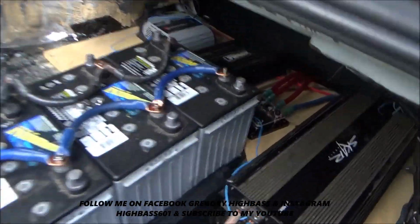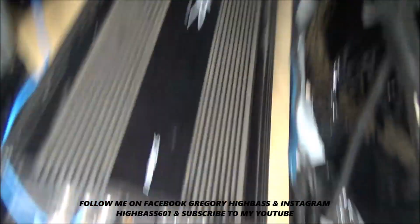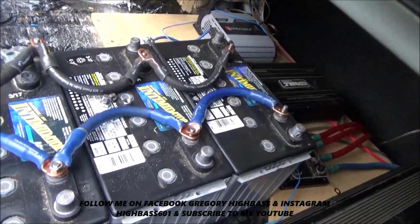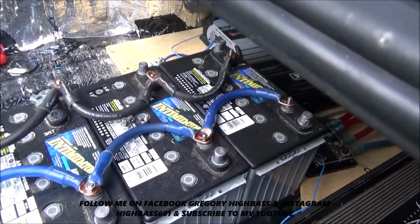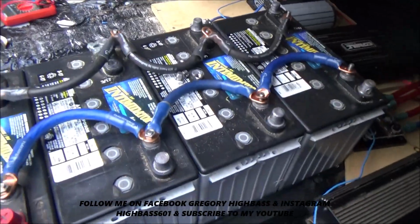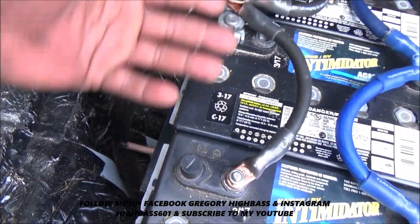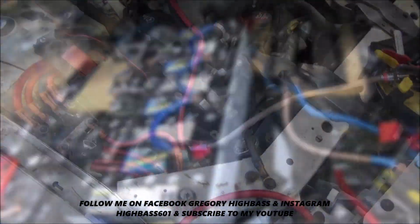So the only thing I got left to do now, I'm gonna start running the 4 power wire cables to the SMD up top. And I'm gonna try to wire everything up in the trunk this evening. Everything. That way the only thing I gotta do is get up on the car and run the 4 grounds on this side. I gotta do away with that one. So I'm gonna run 4 grounds up over here. So let me get going with that and I'll cut you back on.